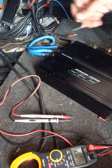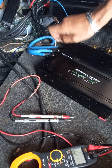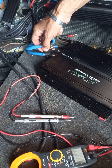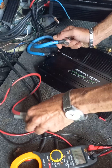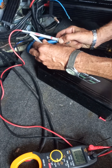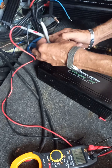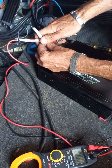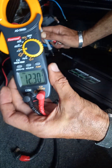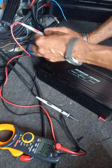So that's out completely. Let's test it while it's not in the amplifier. The 12 volts are back now when it's not in the amp — you can see that. That is not in the amplifier and we've got a 12-volt reading again, which means it's going into protect mode when I put it back in the amp. Unless it's reset, I'll try it once more — I'm going to give up eventually.